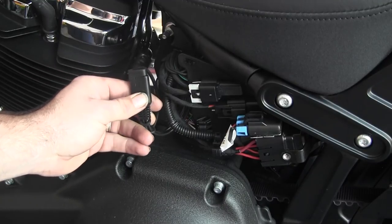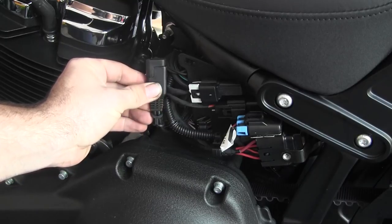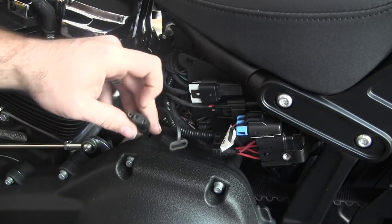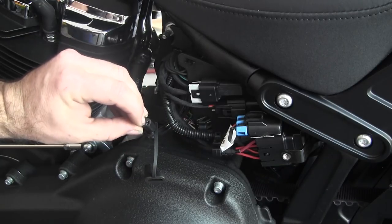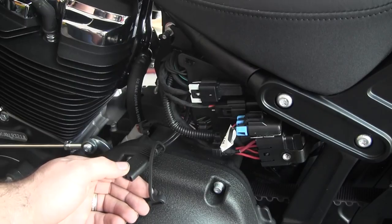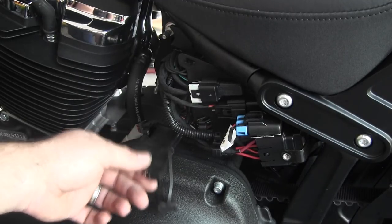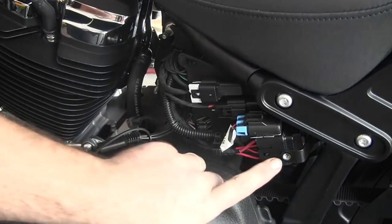The pigtail for the battery maintainer was curled up under here. At first blush — see how wide this thing is — I thought I needed some special Harley-only battery tender maintainer. But when you pop the cap off there's a spade connector right there. My battery tender and the Viking charger from Harbor Freight both connect to this — they just don't connect to that little spade connector. I think the Harley one might have an LED that shows when it's charging and hooks up to that spade connector, but either way you can use a standard tender maintainer you might already have. You don't need to give Harley any more money than you already have.